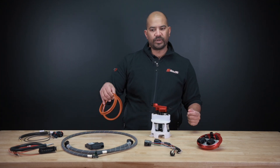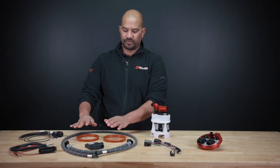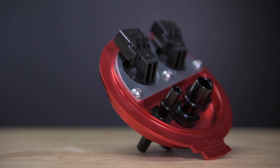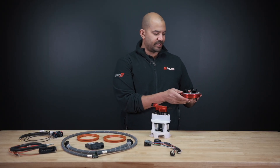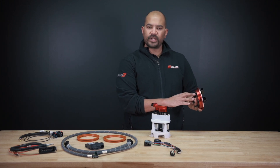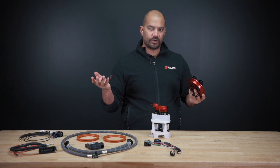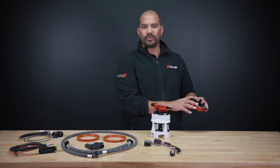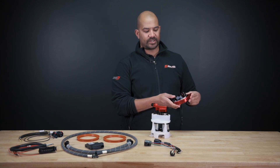It does come with two fuel top hat seals, just in case. And this is our billet top hat assembly here. We have the sealed bulkheads. When you're on a full tank, this is fully submerged in fuel. This isn't at the highest point of the fuel tank, so you want to make sure that the fittings and bulkheads can not only hold fuel sloshing against them, but hold actual pressure as well. So these fittings all go into spec o-ring bosses and can hold quite a bit more pressure than one would hope to see inside of the tank.